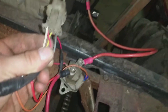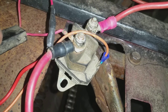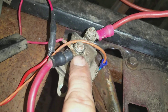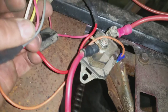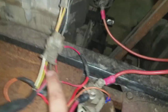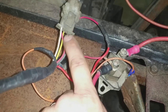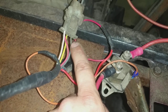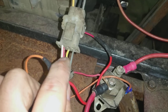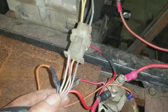That's how you run a push button. Now if you were to run a kill switch, what you would do with the red wire — that's your charge wire — you could run that straight to the battery side of your solenoid. Then the white wire you can run to headlights or whatever. The yellow wire — now I'm saying this is without keys — you can run this to a toggle switch if you wanted. Flip your toggle switch on when you get ready to start it, leave it on. When you get ready to shut it off, flip your toggle switch off. Run your yellow wire to a toggle switch on one side, and then on the other side run it to a simple ground spot. That'll kill the motor.